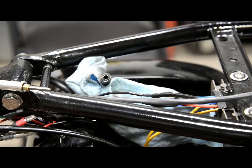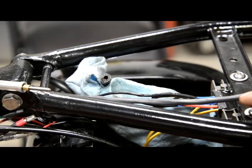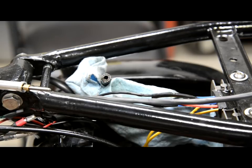You remember when I put the oil tank and everything on, I talked about crossing over the oil lines? Well, I've been kicking myself stupid today on this kickstart, wondering why I couldn't get oil to circulate. So I go to Rupert Ratio's book, and the crossover of the oil lines is only for the end-fed cranks, and this isn't an end-fed crank. So I had the feed on the return. Now, it's a very good example of why I always do it this way and kick the engine over until I get oil out the rocker feed. Because if I'd just started this up, I'd have been standing there looking in the oil tank, wondering why no oil was coming out.